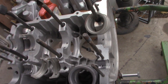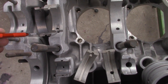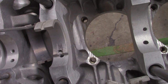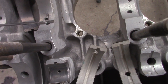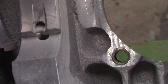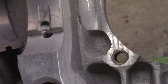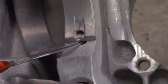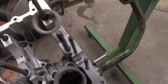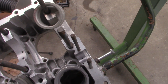And you might as well check it if you're using a mag case too. This is our oil feed hole right here. There's a line in the back of this bearing that you can see here — that's where it picks up the oil from the oil feed hole. Now if you put the bearing in here, you can see this oil feed hole is covered up by the bearing. So we're going to have to modify the hole or the bearing. The bearing's an easier fix, but these holes on these cases are in the wrong spot. If you don't do this modification you stand a really good chance of locking up the flywheel side bearing — the one with the thrust washers on it. This is a very important modification.